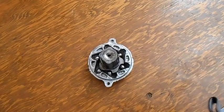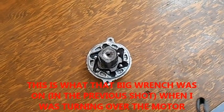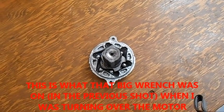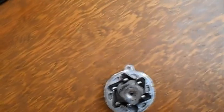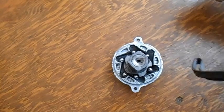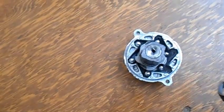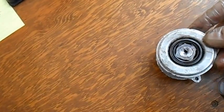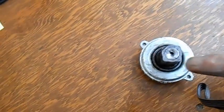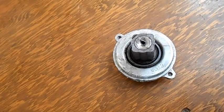BTHV1 here. I just took the rewind clutch off this five horse motor. If you saw my rebuild of the three horsepower 1961 rototiller, that one only had one cog on the clutch. And this one has one, two, three, four, five cogs with six ball bearings. So you can see how much more efficient it is as it turns and engages the small ball bearings. And then this is a two-piece cover — it just fits over here. I've cleaned everything up and there's a piece of felt right inside here. You put a few drops of oil so that felt continues to oil the shaft.